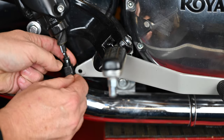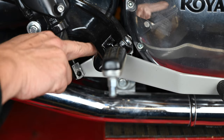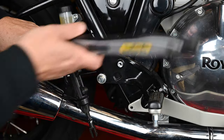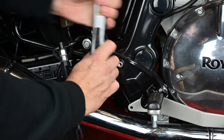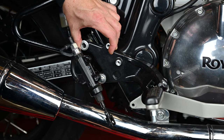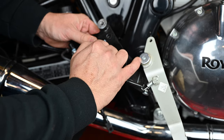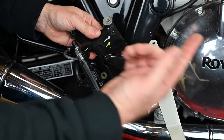There's a mark on there for adjustment for length but it should be the same stock length. Once that's out of the way we can then get this moved and unbolt the bit here. Not being connected to the bike, this will just all come off in one piece. Then it's a 12mm socket or spanner onto these. Remember to hang on to this assembly because it's going to drop if you don't. Then that whole assembly just comes off. You can then disconnect the spring and undo this with an allen key and bolt the new one back into place over on the bench.